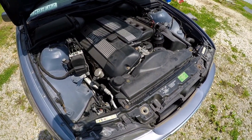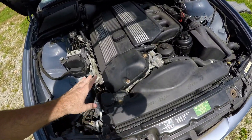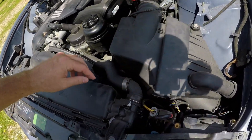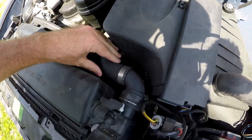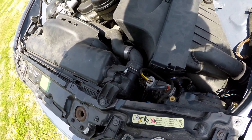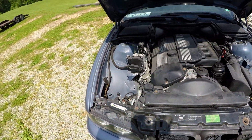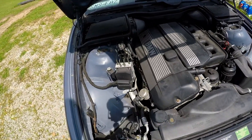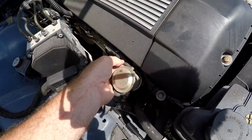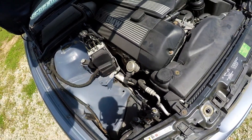There is not even one drip or seep of oil on the manifolds — that's pretty sweet. The AC does work. At 150,000 miles we'll pull the shroud to inspect the AC canister and all the hoses. The hoses look like they've been replaced at some point. One of the radiator support rubber mounts is probably missing, which means it'll eventually rub a hole in the radiator. That's super common stuff. Every vacuum hose and rubber hose on this car is probably rotten. Somebody replaced the secondary air hose — I can tell it's a Chinese one — but we're going to delete all that anyway.